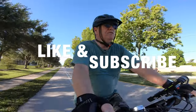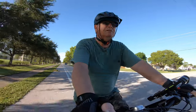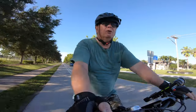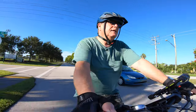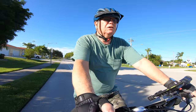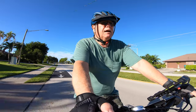Ran into a few fitment issues with the brake. I had to get a 1 millimeter spacer and space the rotor out 1 millimeter. That wasn't a big deal. A little bit of research on YouTube showed me there was a spacer available. Somebody else had it when they put in their mechanical hydraulic hybrid brake calipers. So it looked good for me, so I ordered one to space that rotor out 1 millimeter.